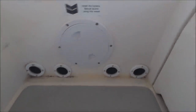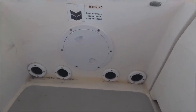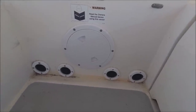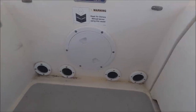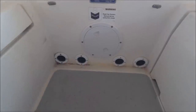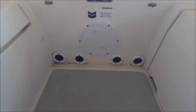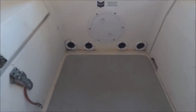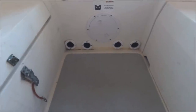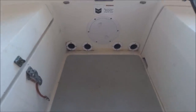An access plate was put in trying to access the upper rudder gudgeons, but it turns out there are no nuts inside — it's just a cover plate. The factory must have had a bronze or stainless plate fiberglassed into the transom that the bolts tapped into. Below that are the extra drains installed to help the cockpit drain faster, with one-way valves on them.